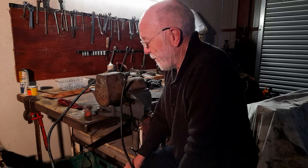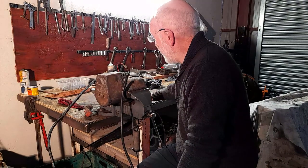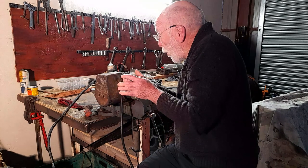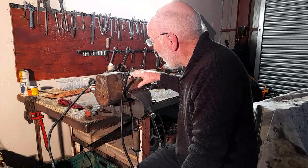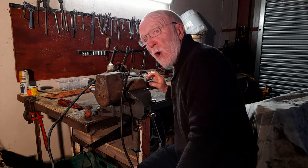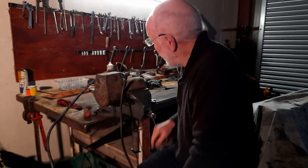You certainly don't want to repeat that sound because you'll very soon screw up your pinion. Let's go back to the first scenario — probably the simplest. You turn the key and all you get is a thump. What's happening is the auxiliary winding in the starter is just not strong enough to bring the rotor forward. By virtue of a short circuit or open circuit on the auxiliary winding, the rotor isn't coming forward strongly enough to engage with the starter ring teeth and allow the full current to come on.